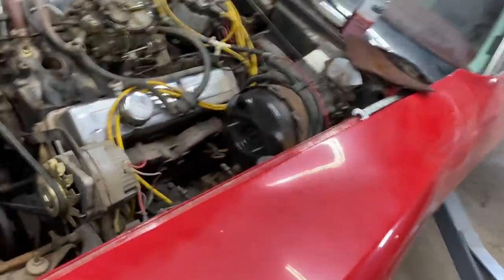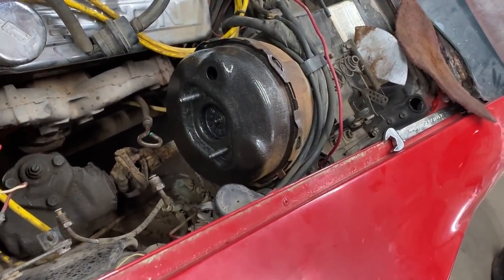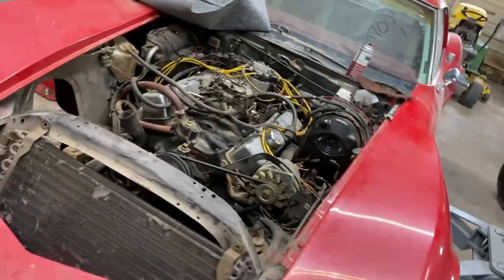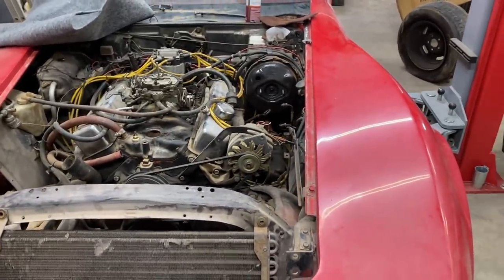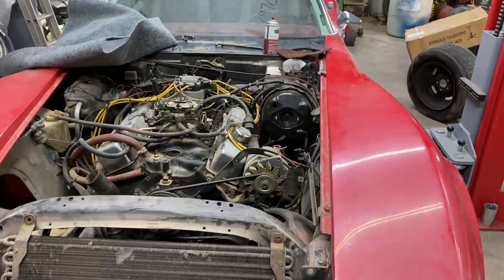All righty. I scuffed down the front of this thing, shot a little paint on it to get rid of some of the rust. That master cylinder had been leaking as well — the bottom side was covered in nasty and rust. So we're going to let that dry, then I'm going to get the master cylinder on, but I'm not going to hook up the brake lines just yet. I want to go ahead and get it up in the air and get all the calipers on. I blew out the brake lines and made sure they were clear — it was coming out of all four corners. Everything looks good. All the brake lines I've seen so far, I'm pleased with. I don't see any excessive rust, just a little surface rust. I got new lines for the front and lines for the back.